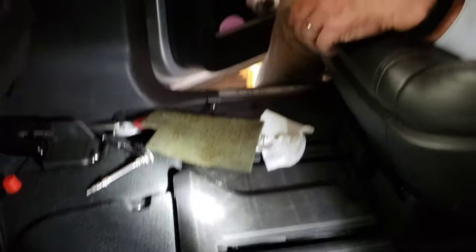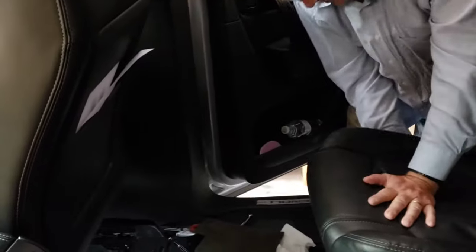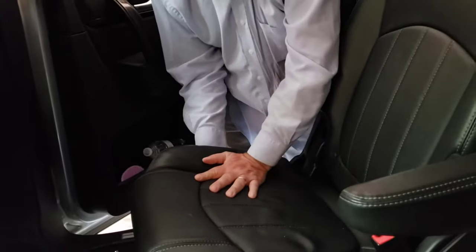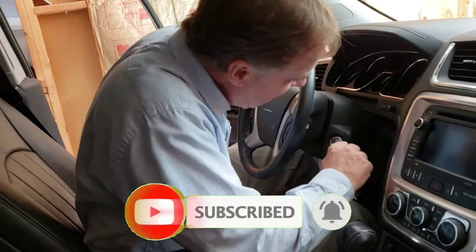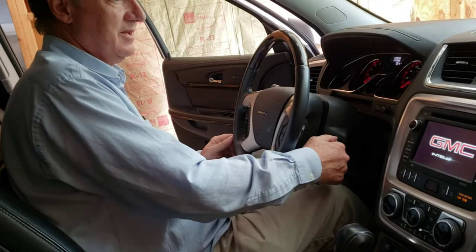That's how you replace the battery in the 2016 Acadia Denali — it's behind the passenger seat. Before you take the cover off, you need to put the passenger seat all the way forward, and push the rear seat all the way back so you have room. Put the seat forward, the other seat all the way back, and then you can get at it. That's all there is to it — thank you for watching. Looks like the battery fixed the problem. Another job we did ourselves!